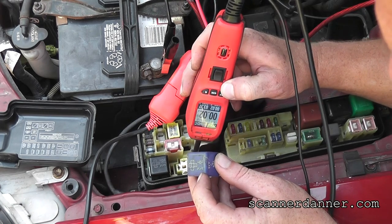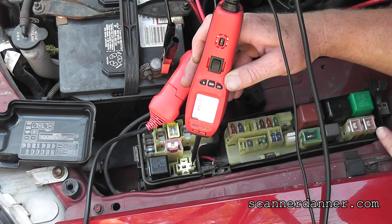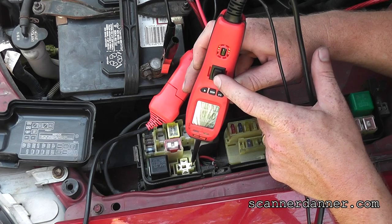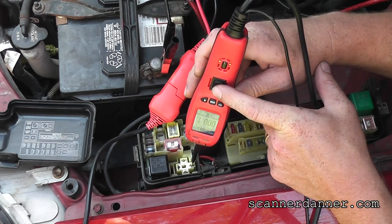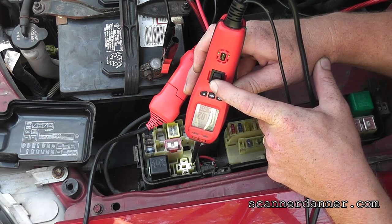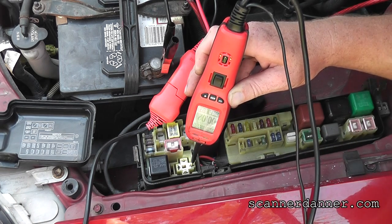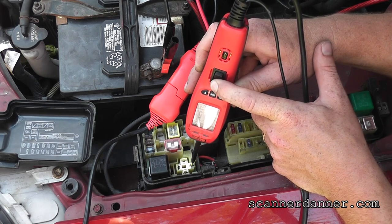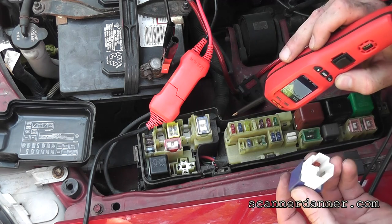This goes down to the starter motor, right? What you can actually do with this tool, and this is where we need to be careful, is if I go in the forward direction, I'll send power to the starter. There's 10.4. The fact that I'm doing this right now and nothing's happening means everything is good and our problem is down there. And the fact that it's dropping to 10, well, that kind of sucks for me though. Yeah, this might be a bad starter. We might beat on it harder.